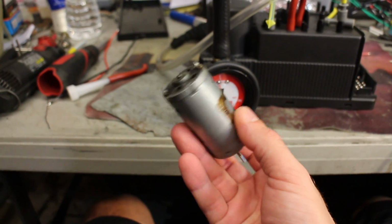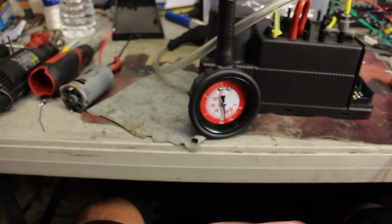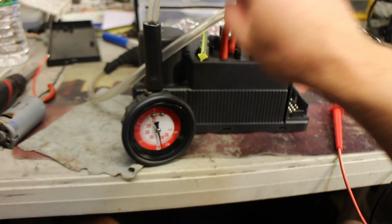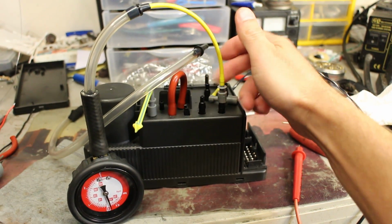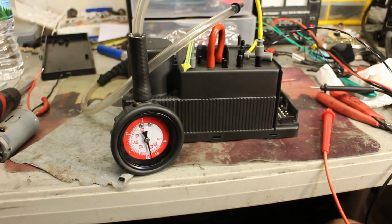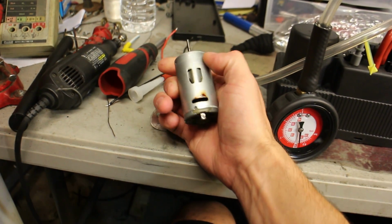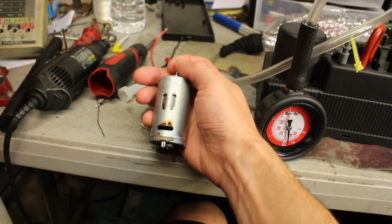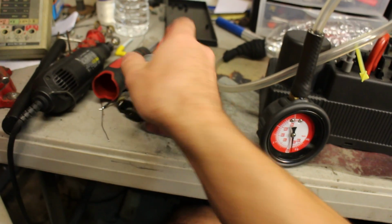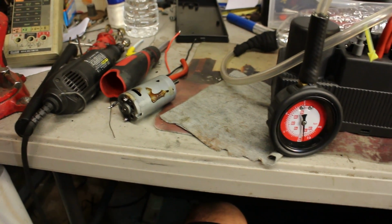This isn't right. So I'm thinking you have a leak somewhere in the pressure circuit for sure. The pressure circuit for lumbar supports in your front seats, because that's the only explanation. To get this motor in this state, it had to work non-stop. So that's basically what happened. Running non-stop, the motor melts too much.